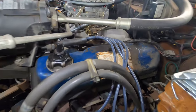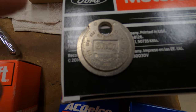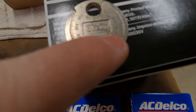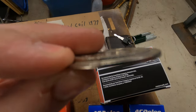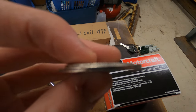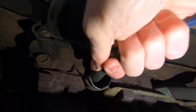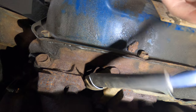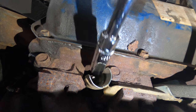I have a spark plug gapper, so we're just gonna do that. Here's what a spark plug gapper looks like — it's just like this circle, it's from O'Reilly. It's kind of hard to see, but there's 0.020, 30, 40, 50, 60, 70, goes to 100, and you can see how it turns — it goes thinner and then wider. Let's see how this plug looks.